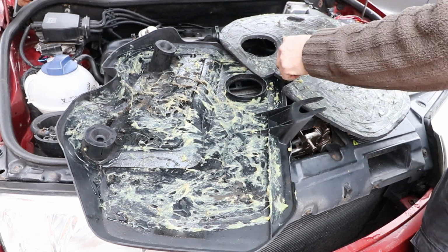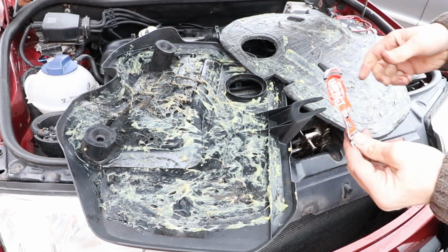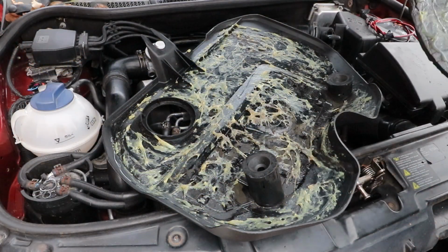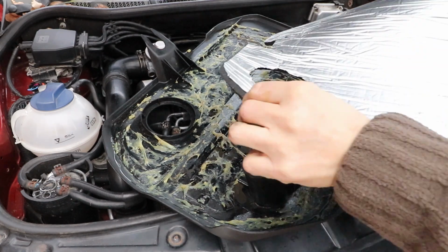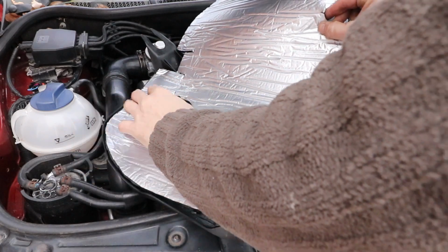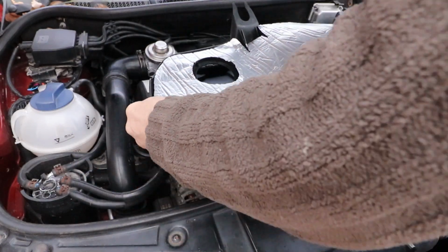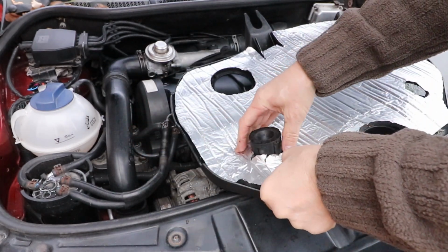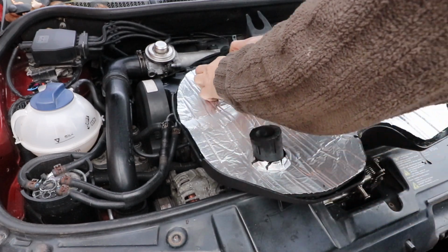I'll look online and put a link in the description for the foil covered foam and the adhesive. Leave that to dry a while and then carefully line it up into place. I started with the oil filler hole being the easiest place to start from, lining up from the side and the top edge, and then pushed it over the two pegs and press it firmly down.